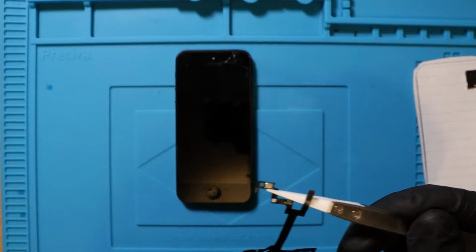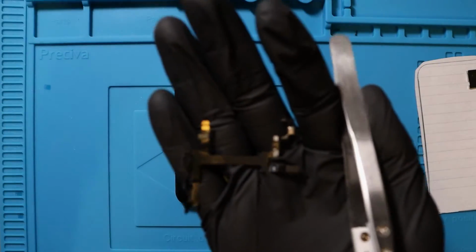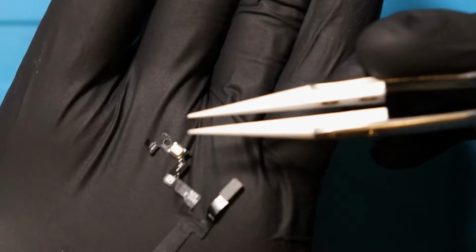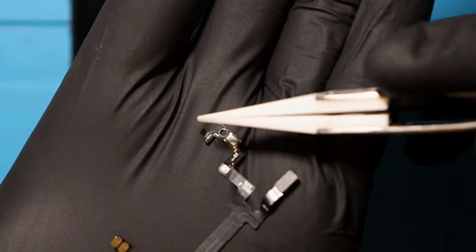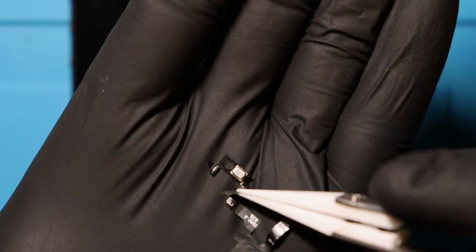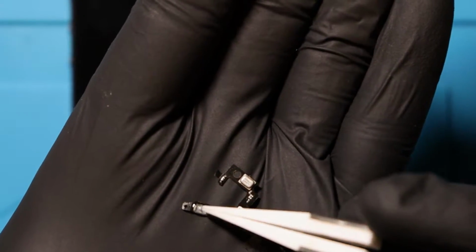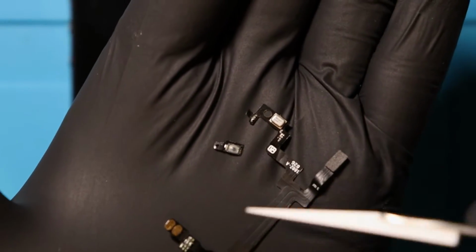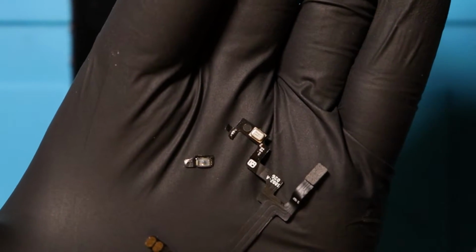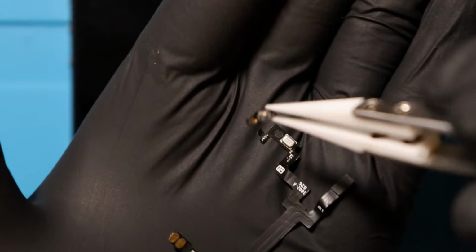Now I know why the other power button was not working. So this is where, this bit here, I'm going to try and do this as best I can with as much light as I can, so I do apologise if it is a little bit shocking. At the top here is where the power bit is, and usually there's the button bit, which is here. The button bit that I found is there. It was attached to the button, but it wasn't connected. So this is the actual button that you push to switch the power on and off, okay? That wasn't attached. I didn't realise until I actually pulled the physical mechanical power button out, and that was the issue, because this was glued onto the back of it. So it had completely snapped.